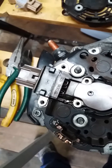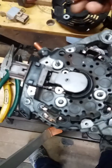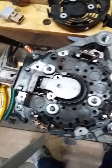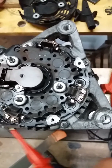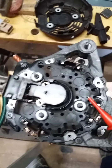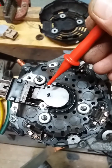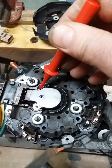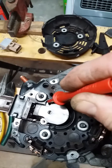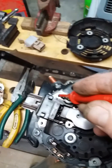To get to this point, obviously you remove it from the car and remove the black cap, three nuts, and the shroud that covers the B-plus terminal, then the securing bolts for the rectifier around the outer edge, and the securing bolts for the brush assembly — this one being the ground and this one being the variable up to battery voltage.